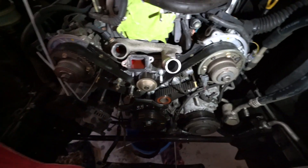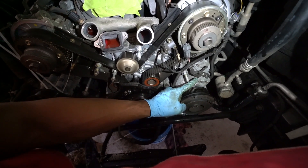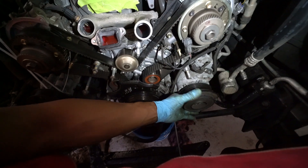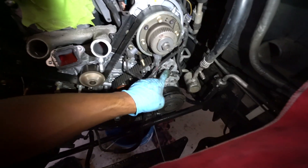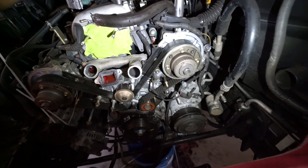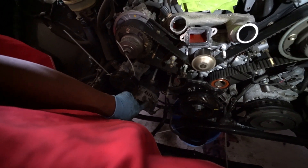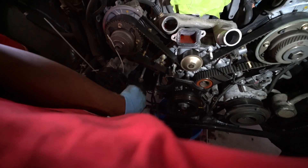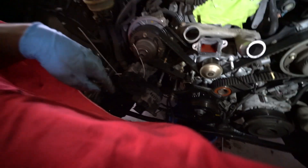We got both timing covers off and took this pulley off — it's a whole bracket right here. You have to take out two of the four compressor bolts, just the two front ones for the bracket to come out. Take out this little bracket with the two 8mm bolts — it just slides right out. You do have to take the alternator off to get to the cover over here. Took out the alternator mounting bolts and hung it up out of the way — don't need to take out the cables.